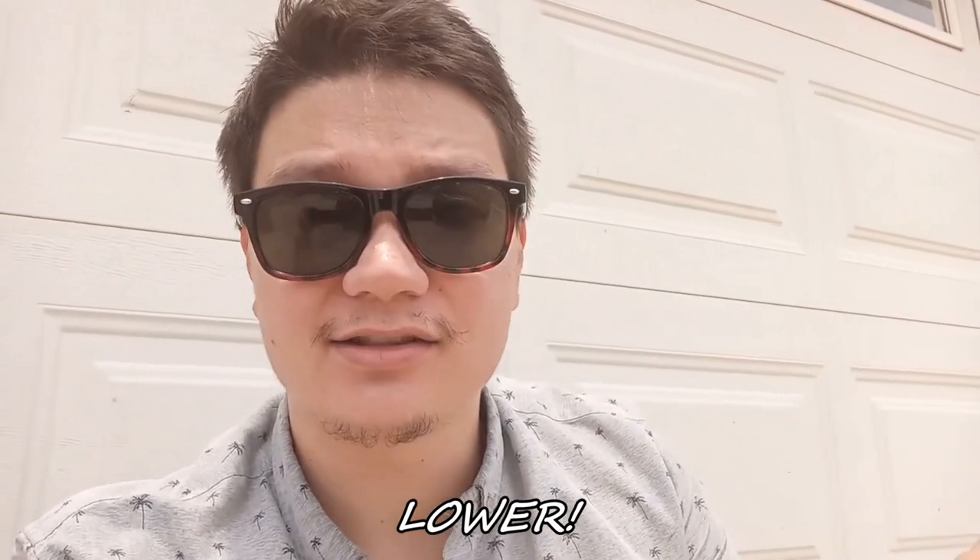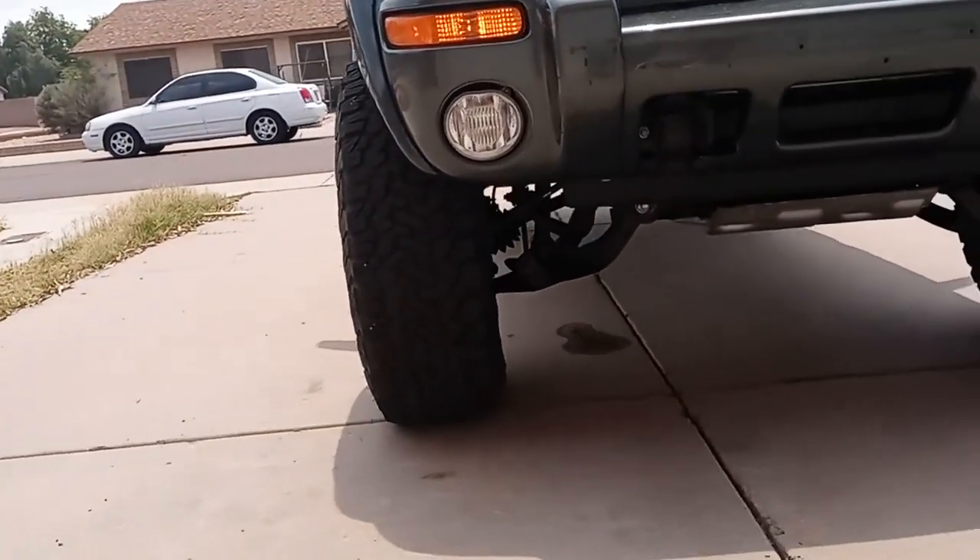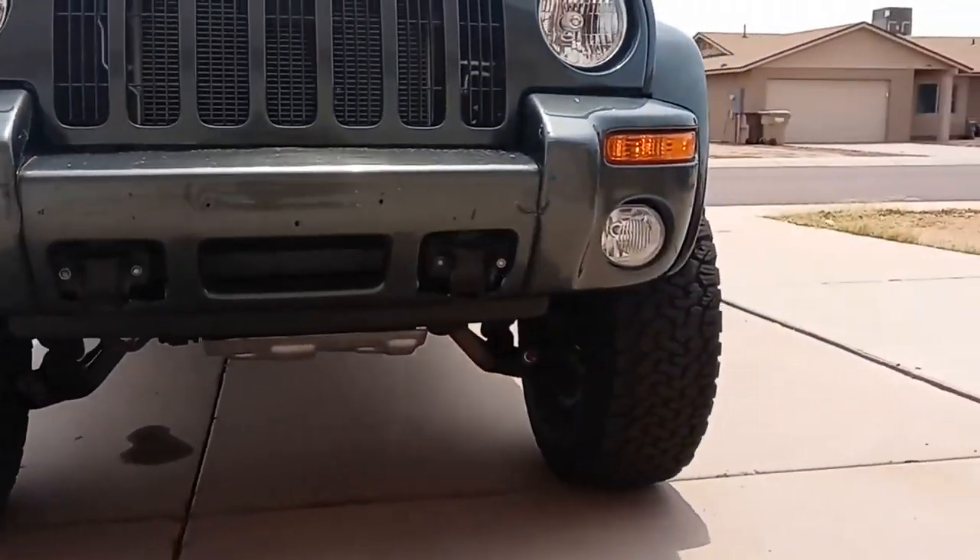It's mainly like that because my driver's side is lower than my passenger side, which means the upper control arm is higher on the driver's side and it's going to pop the tire out just that much more. The other day I raised my driver's side up about a quarter of an inch, maybe three-eighths, and it did bring the upper control arm in a bit more — that's why it's only a quarter of an inch now. Let me get this camera turned around and we'll take a look — this side is pretty much straight, and this is the driver's side.